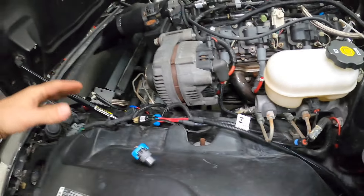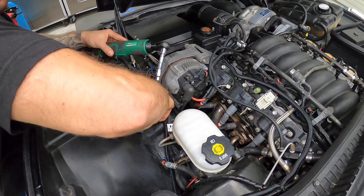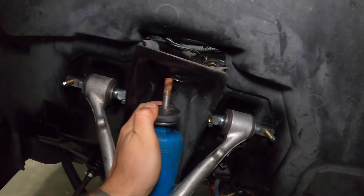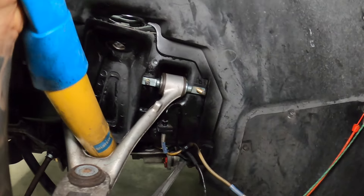Then we can start getting the old shocks out and getting the new ones in. With our upper control arm removed from the vehicle, shock disconnected, sway bar disconnected, and outer tie rod off, you can actually swing the whole suspension out. You really only have to do one side. It's just a matter of those 13mm head bolts, and then we can take this whole monoleaf out. Once we lower it out of the way, the monoleaf is ready to come out and we can discard it. At this point, we can put our upper control arm back on the vehicle.